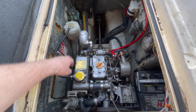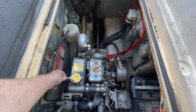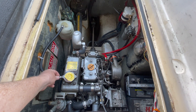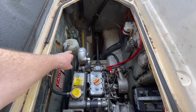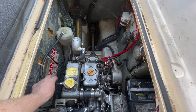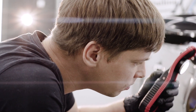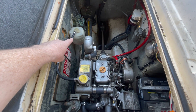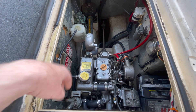The reservoir I cleaned out — there was like an eighth of an inch of mud. Remember when I pulled this off and it broke? It ripped open; there was just nothing there — everything was deteriorated. The mud I saw under here sure looked a lot like deteriorated hose material; I think that's what I was seeing inside the coolant system itself. So I think it needs to be cleaned out more frequently — I might even get a new one and just replace it.